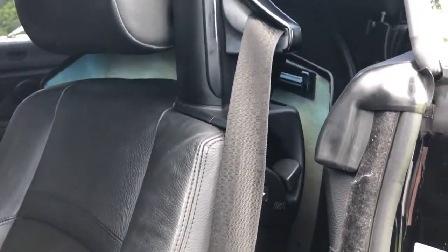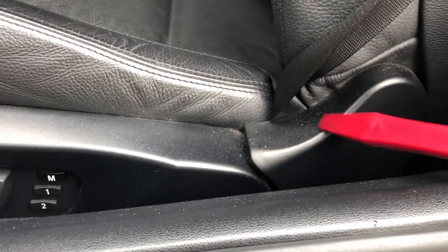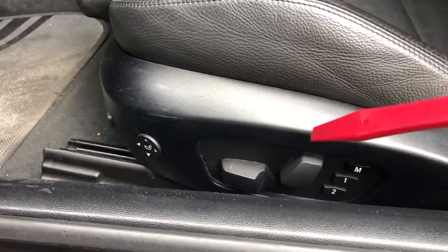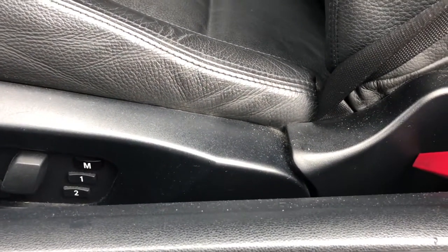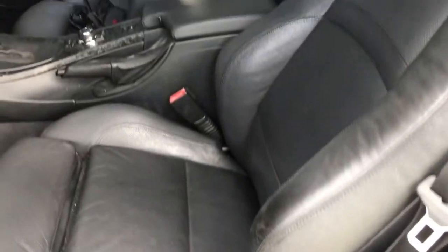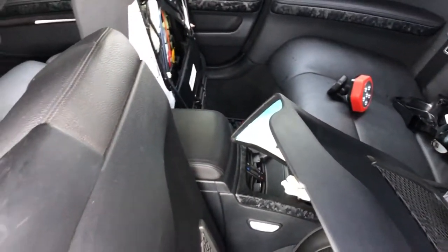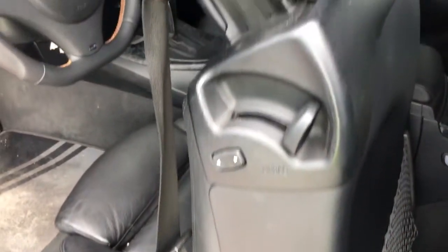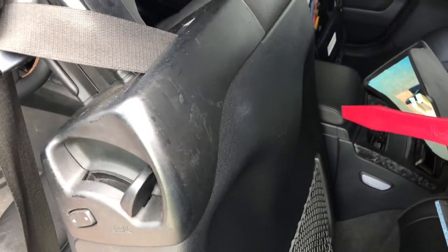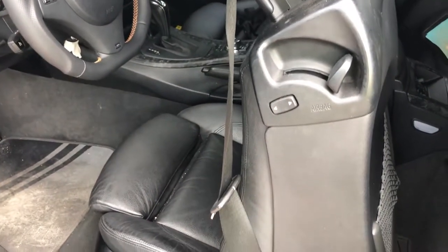You'll see it's different from the E90 and E92 where the seatbelt is on the B-pillar. On mine it's attached to the headrest and runs all the way down the seat. The first thing we're going to take off is the cover here. Then we remove another piece to access the bolt in the back, which is a 19mm. We also need to remove the rear panel to get behind there, where the harness reel itself is bolted on.